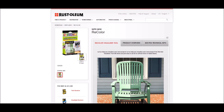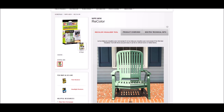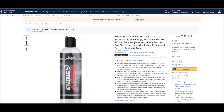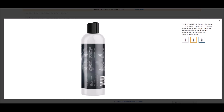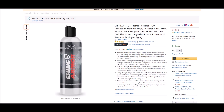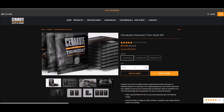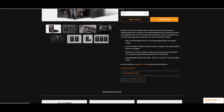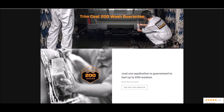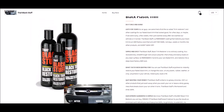Wipe New Recolor contains chloro-4-(trifluoromethyl)benzene, also known as PCBTF — it's an extremely strong solvent commonly used in silicones — and it also contains polysilazane. Shine Armor is the next one; I requested an SDS from them and never heard anything back, so I don't know what's in it. I bought it on Amazon in August 2020. Cerakote contains alkyl polysilicate, a solvent and refractory resin — a different way to get to an end result — and it has a 200-wash guarantee.